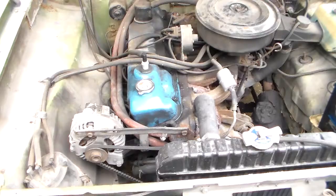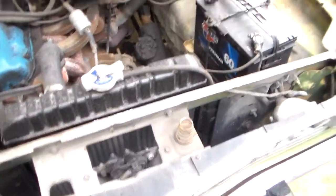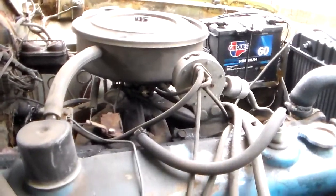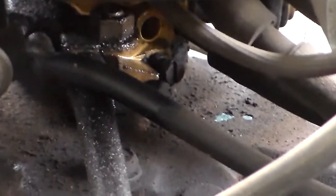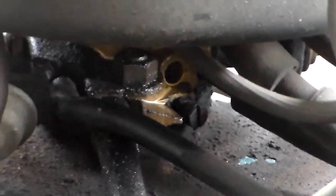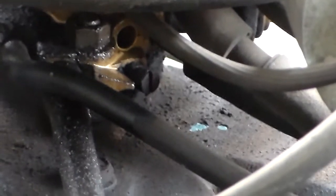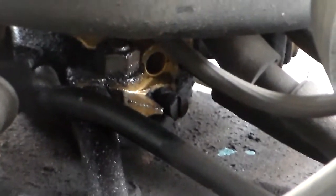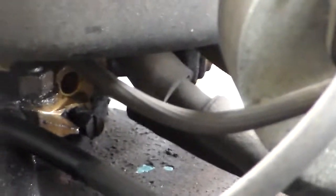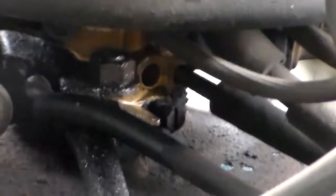I'm going to do a little tinkering with this — change the oil filter, tune it up, run the valves, see how it runs, and then we'll see if we need to go into that carburetor. Taking another peek under here at the carburetor — you see that thing that looks like a screw head where you put a screwdriver in? That's actually a plastic limiter cap on the carburetor mixture screw. They put these on cars back in the day to keep people from running it too far lean or too far rich and upsetting the emissions.